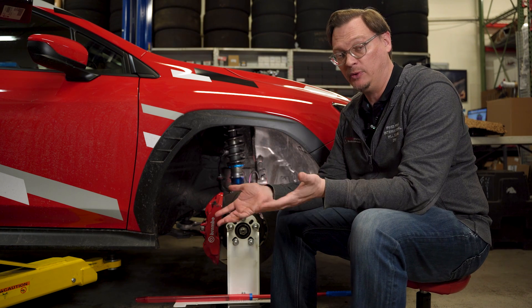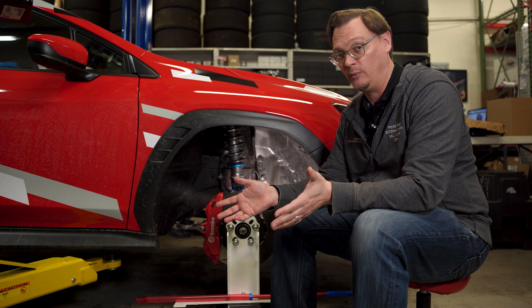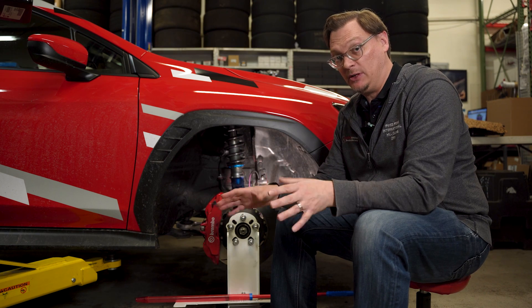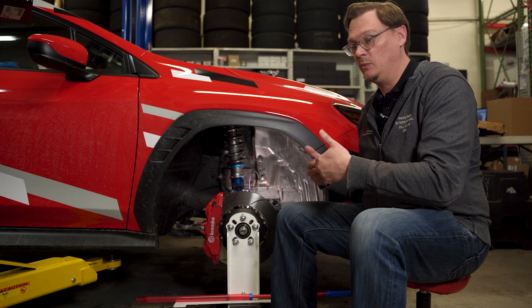Also, because we measured our ride height, we know that as we put the car on the ground it was sitting one inch higher than the stock suspension — so we've gained one inch of ride height. With that as an example, you gather all of this information by just putting the car on the ground the first time, then compare the results with the suspension on the car to what your goals are.